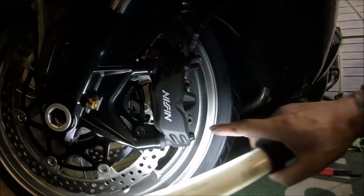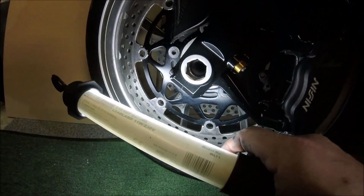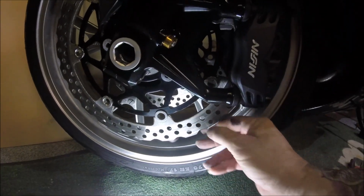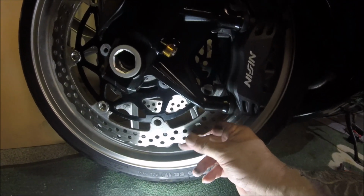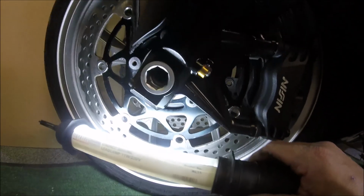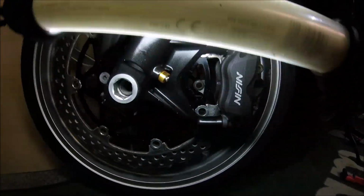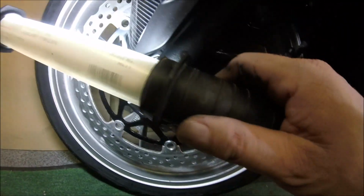I've had issues before taking the caliper bolts out and ended up having to cut one out. Not brilliant. Discs, again, not brilliant. I've seen worse, but they're not brilliant. So we haven't got a lip on the inside or the outside, but you can see they're lightly scored. Now this was MOT'd 2 days ago and apparently had no advisories, so it sounds like a bit of a dodgy MOT to me, but I can't say for definite because I've not got a caliper out on them yet to see how much they are worn, but they are slightly scored.